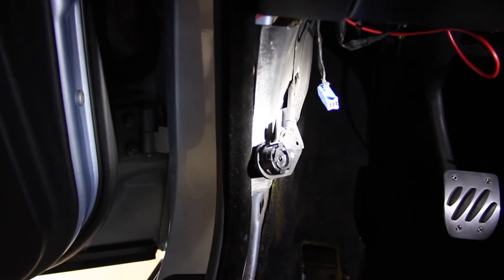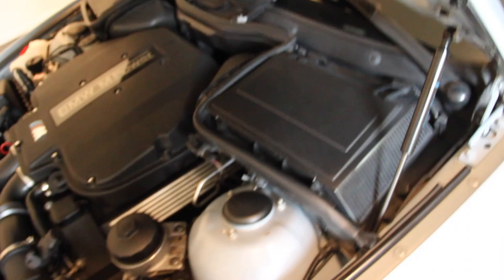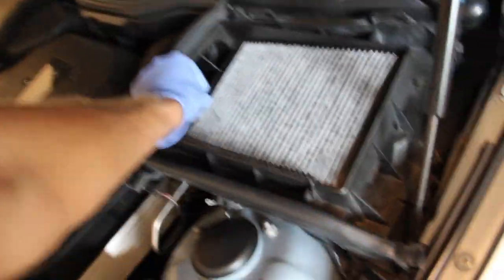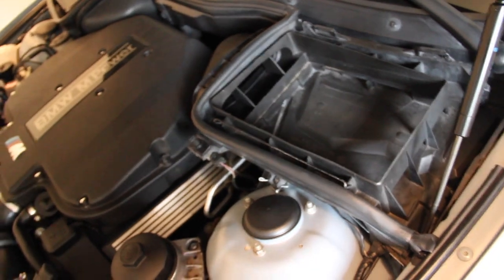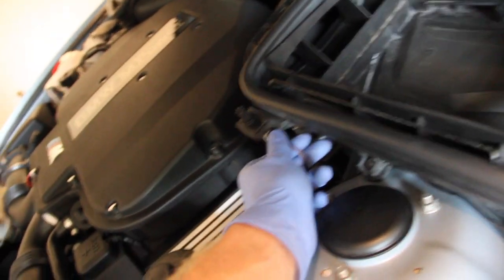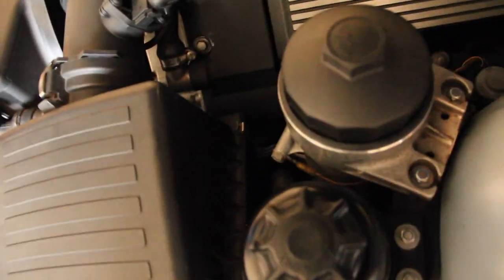Make sure you have your hood open before we get this far, because now it's a little more challenging. We're going to come out under the hood and take apart a couple things to access where the cable goes through the firewall. First, remove your airbox lid, then your filter — great time to inspect and replace if necessary. There's a small clip; pinch the tabs in and pull. Then there's the hood sensor — just pinch the wire harness on it to disconnect.